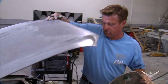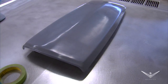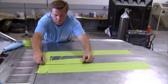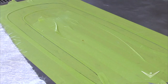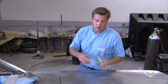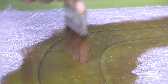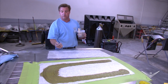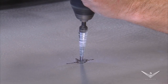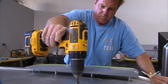Chip's design for a high-performance Mustang includes a proper hood scoop. Mating the scoop with the steel hood will require some fab work and a flange that assures a tight and clean fit. He's laying out with tape where the flange is gonna be, then glassing that up. From the underside of the hood he'll drill the holes back out, put the hood scoop back on, and when you pull the bolts tight you're not actually pulling big lumps into the sheet metal.